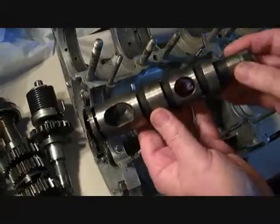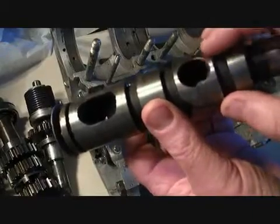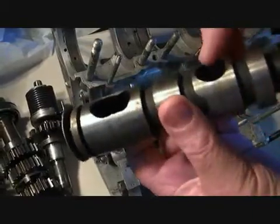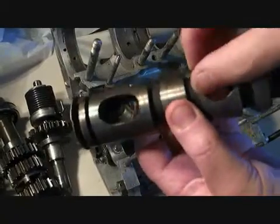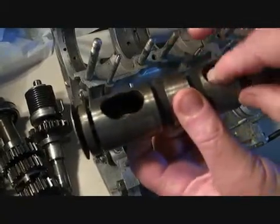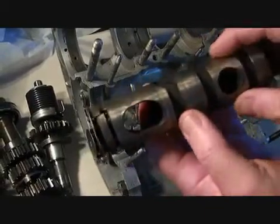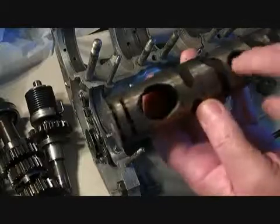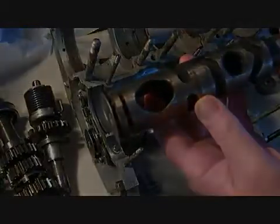It's kind of hard to tell, but if I can get close enough — you can see where it has been radiused, but if you look inside there's still a sharp edge here and a pretty sharp edge there. So what you want to do is make sure this is a nice rounded chamfer all the way around to reduce the likelihood of the shift drum breaking.